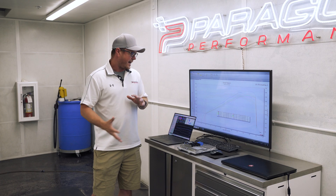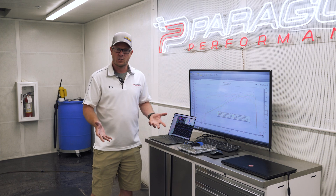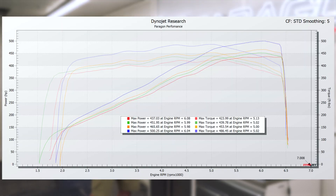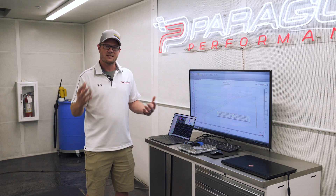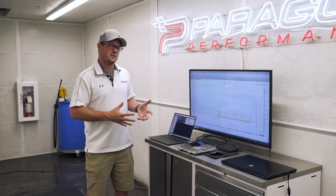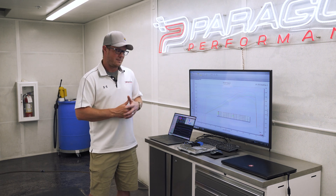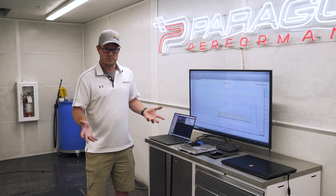The next thing we did was start tuning. We can't add power if there's knock, but we can clean it up — run a better timing curve for 91, better fuel curves, optimize various things in the tune to get rid of the knock. And that ended up picking up some power where it was being lost from aggressive timing being pulled. We ended up at 451 horsepower and 439 torque. Not a crazy amount of power — we know these cars can baseline higher with better fuel and no tuning. But this is optimized for 91, which means tuning could still be nice for people in locations without access to 93 or better. You want to race the car, you don't want the engine wearing prematurely from knock. A custom tune can have the car running much better even without necessarily gaining horsepower, and to some people that's valuable.